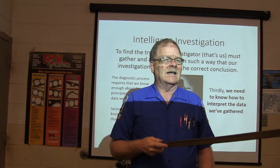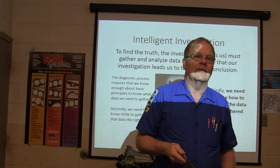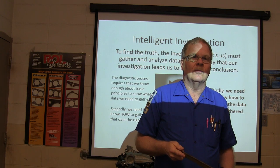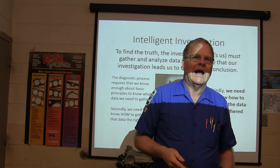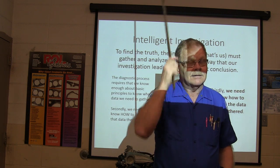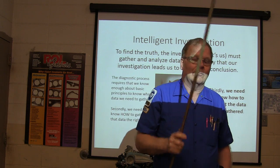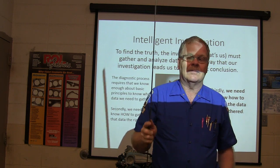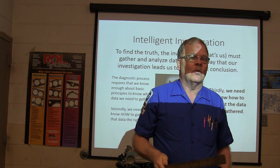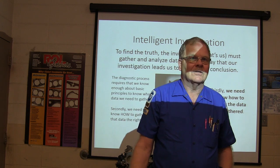The reason I like Electude is because there's a lot of stuff I'm going to forget to tell you — stuff I've known so long I think everybody ought to just know it. For example, you don't put the lug nuts on with the tapered side out. And I've actually seen people that did brake job after brake job correctly, and then on a really important brake job, they put the pads on with the metal toward the rotor. I couldn't believe it when I saw it happen.